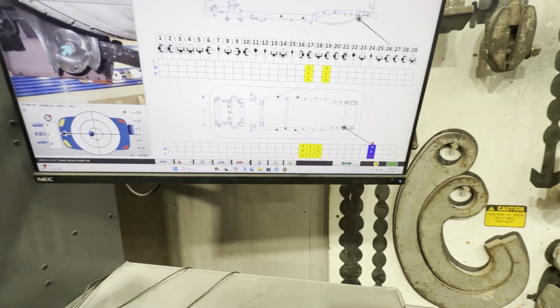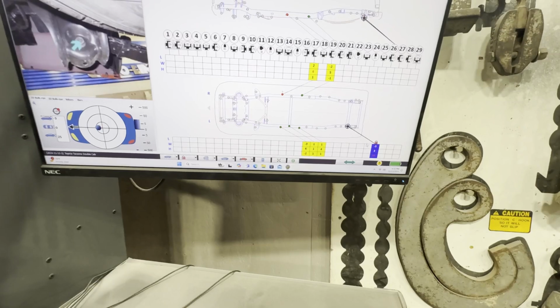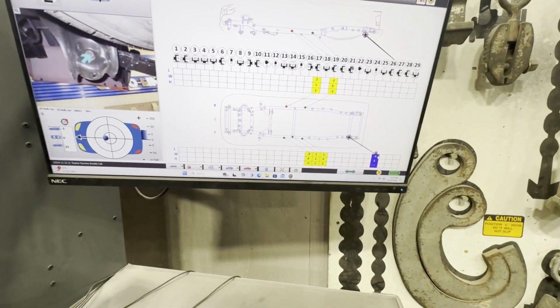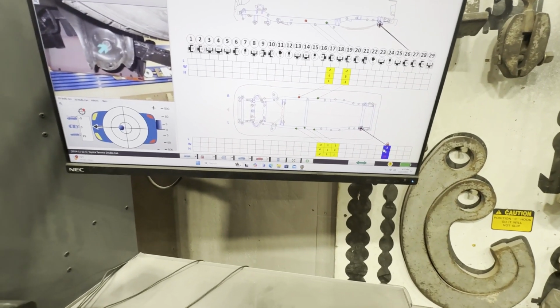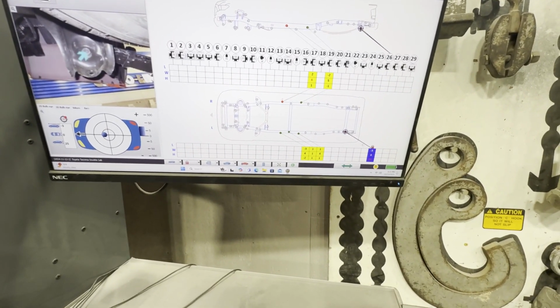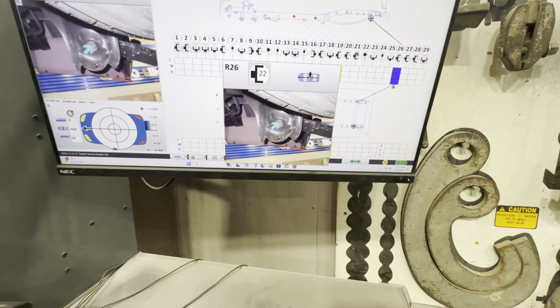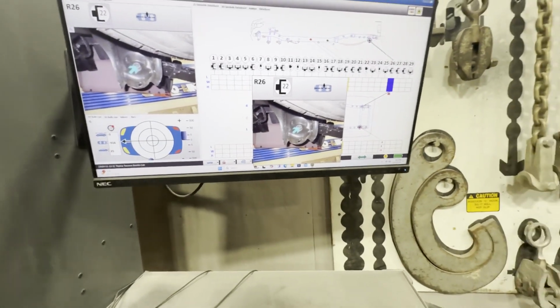Any which -3 is fine. That's showing it's 3 millimeters back from spec, which on a truck, our tolerances are like 5 millimeter, give or take. So that's still within plenty of reason. So now we're going to swing over and hit it on the opposite side. Same point, just opposite side, and see what that says.